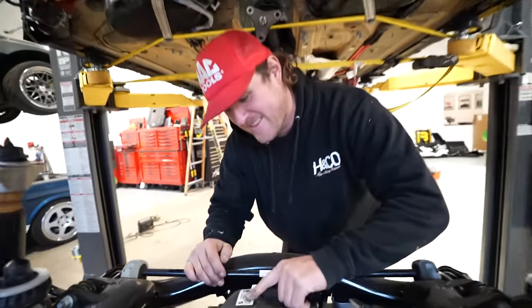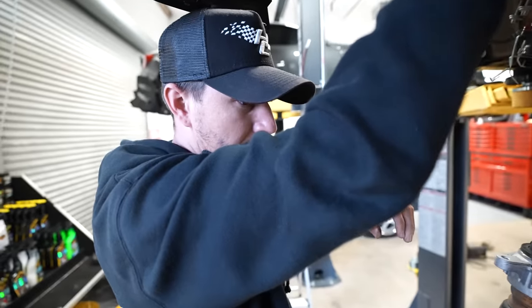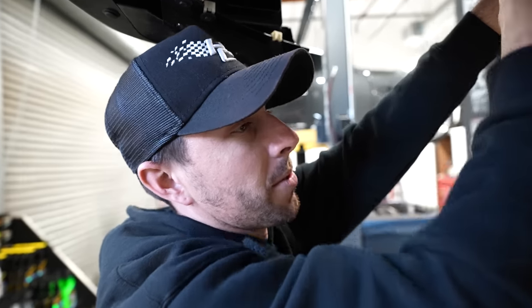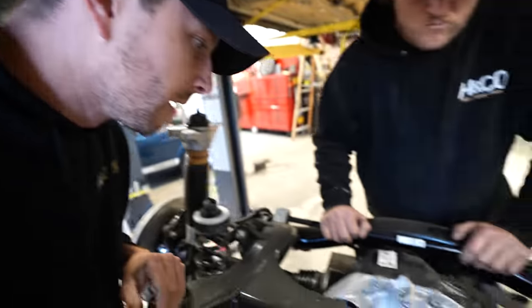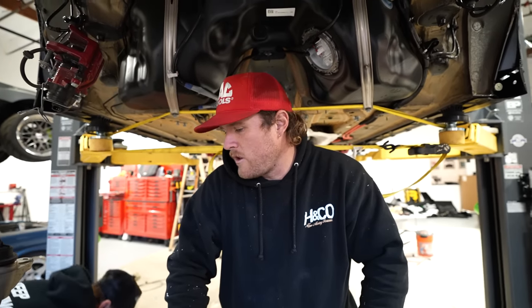Oh, look at this. Hey, sorry, all you A90 Superboys out there. That's a 346, baby. Everyone else got a 315. Which sucks, because when we blow them up, I wish they were going to be easy to get. We can just get a ring and pinion. I'm sure they make a ring and pinion for this gear set now. So we'd have to rebuild it, which is not the best. I speak cars too. Hell yeah. Nice, bud.